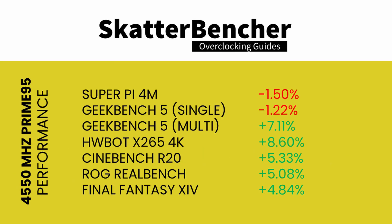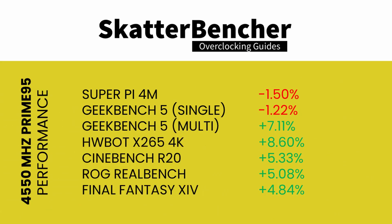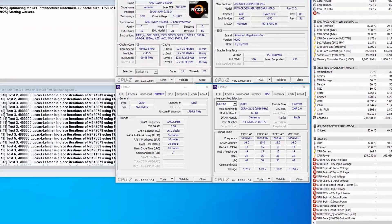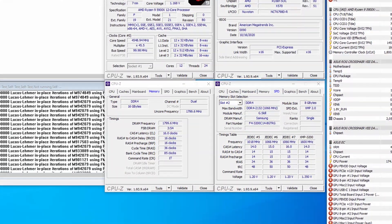We reran the benchmarks and checked the performance increase. A few things to note: First, just like with the previous generation of Ryzen CPUs, we lose performance against default settings in single-threaded light workloads, because by default the frequency would boost to 4.8 or 4.9 GHz, whereas the manual overclock limits us to 4.55 GHz. Second, overclocking the fabric and memory has a positive impact that helps overcome some of that deficit. Third, in multi-threaded applications, we see the performance increase of the additional CPU frequency amplified with the raised fabric and memory clock. Running Prime95 Small FFT with AVX at 4550 MHz, we're seeing peak CPU temperature of 88°C and peak CPU package power of 209 watts.